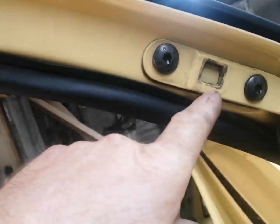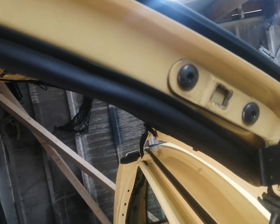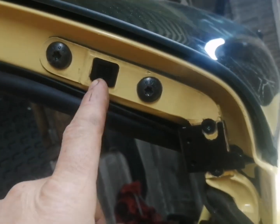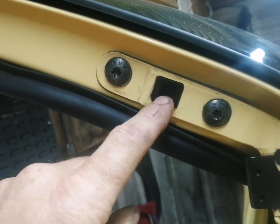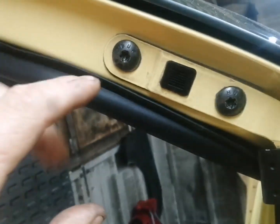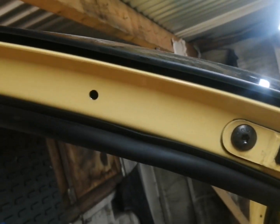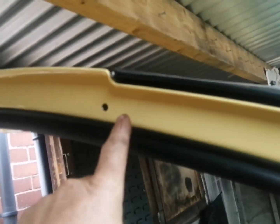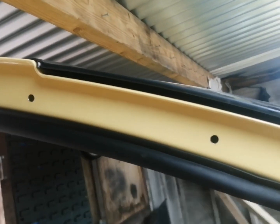Next thing we're going to do, guys, is put these bungs in here, or these clips in here where the side trims fasten on, and get those on. Okay, so here we are, is the new bung what I fastened in. This is where you screw fasten the trim onto the side of the tailgate. It screws into that. What I've had to do on this side is drill the holes to mount the plastic trim, because on the V70 tailgates they don't actually have them.